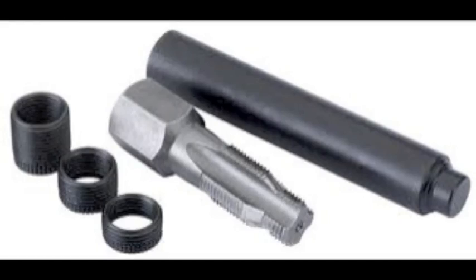I'm going to tell you what I did because I already started and it's really late and I'm half asleep. First of all, instead of buying a new cylinder head, I went out and bought something called a Helicoil. It's a smart idea — what you do is you get the tap that comes with this set and it makes the hole larger, putting new threads in there.